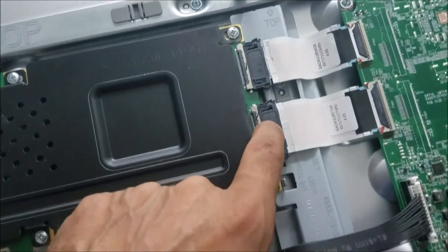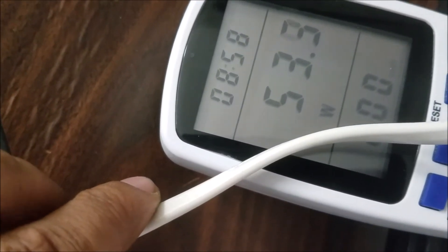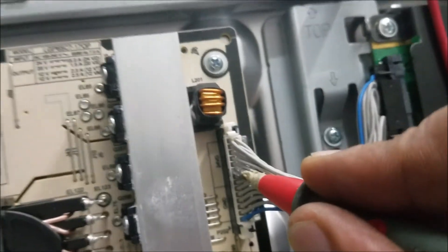I've put the board back in place with all the cables connected. Let me turn on the switch. The TV is turning on, taking about 50 watts. Still didn't see anything on the screen at first... but now we have some display here. The screen works! Here we go — we got this TV fixed. The 24-volt and 12-volt rails are both reading correctly now.